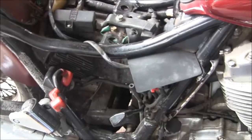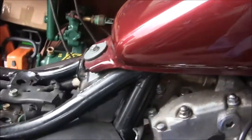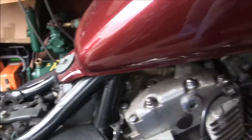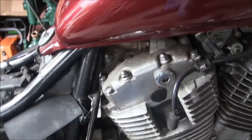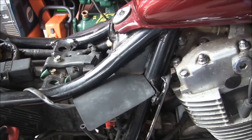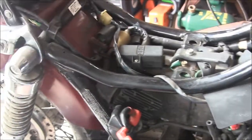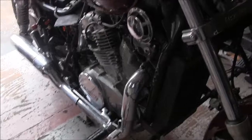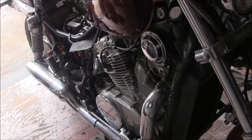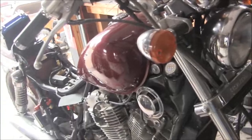I think I'll be able to get it in there. If not, we'll have to find a different place for it. Then I've got to do the brakes, do the clutch — I have all the parts for that — change the oil, and I'll probably have to pull the carbs off and do something with them because they've been sitting. I did drain the fuel five years ago, put oil down the spark plug holes, and changed the engine oil, so it shouldn't be too bad. But we'll probably have to take the carbs apart, soak them in acetone, and blow them out with compressed air.